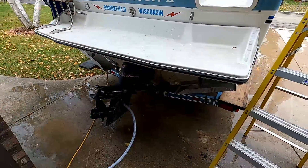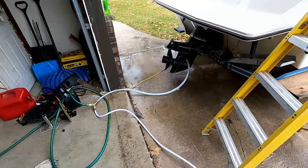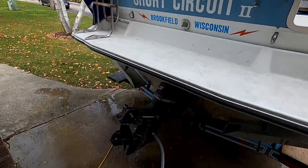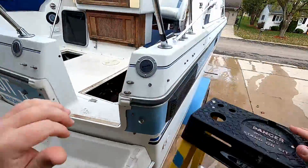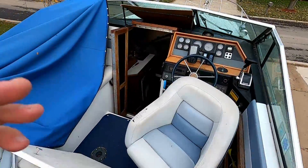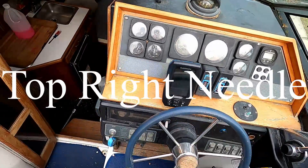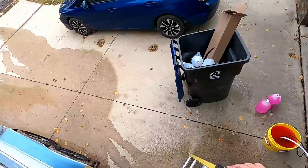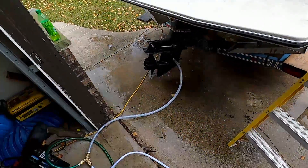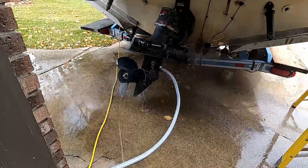This hose goes over to my winterizing bucket, and of course that's got a pump in it that's plugged in. I just have to flip the switch, and when the time comes I'll turn the water off. This is kind of a homebrew setup — I know there's a lot of options for gravity-fed, put the bin up here kind of a thing, but I'm going to do something a little bit different. All right, turn this back on. Temperature's at about 150 — that's about where the thermostat will open. Water up, water down.